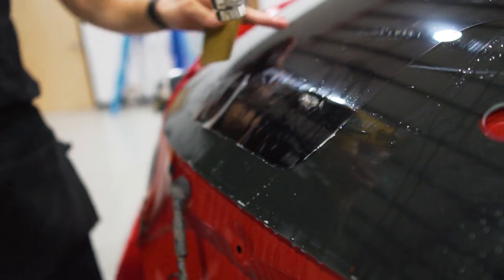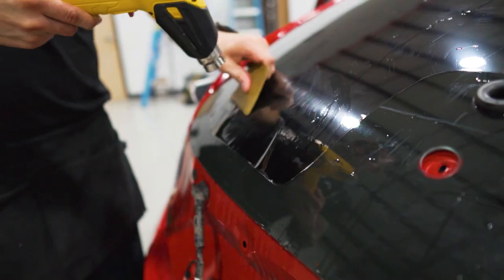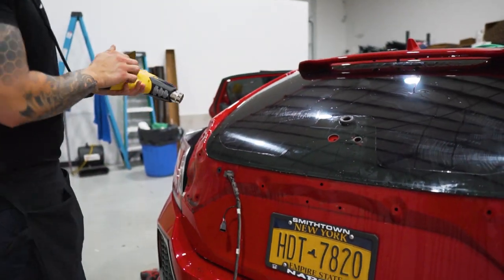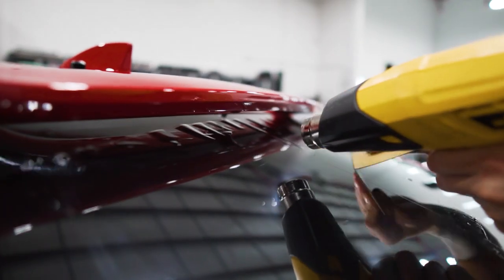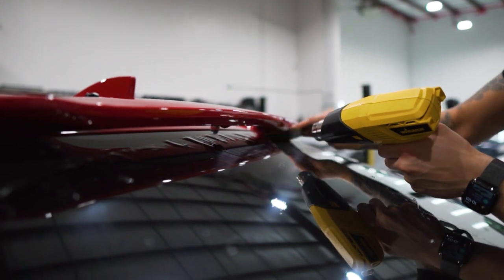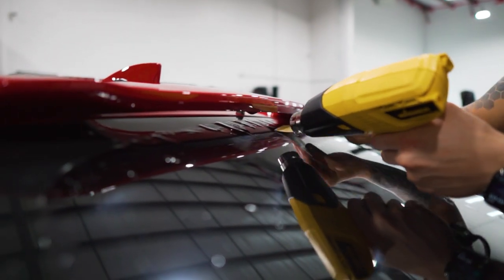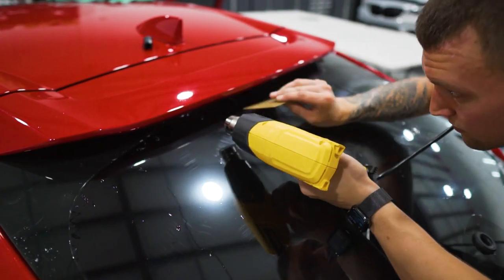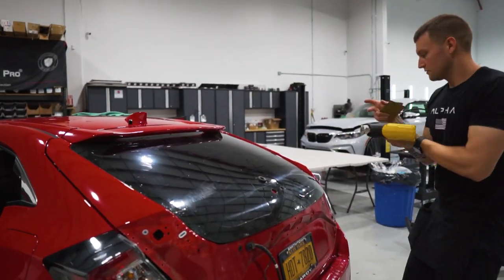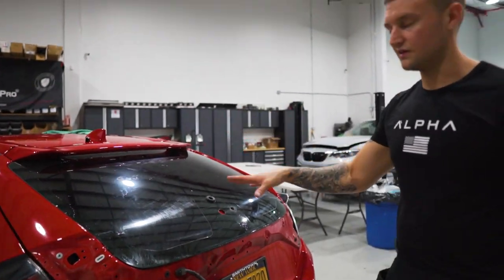If you are wet shrinking, spread the fingers out as much as possible and don't overheat it. There's definitely a lot more tension on this side — that glass is hot. Let's finish shrinking the top quick. Notice when I'm wet shrinking I'm using the gold card. I'm sure you can wet shrink with the felt card, but the gold card really gets all the water from between the film and the glass out. This top wing does get a little annoying, but you can make it work.